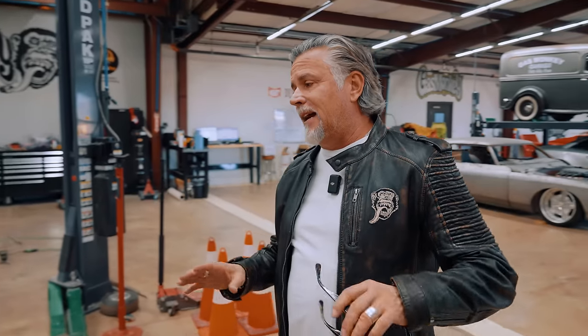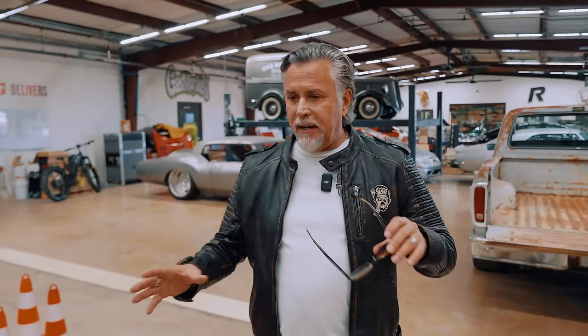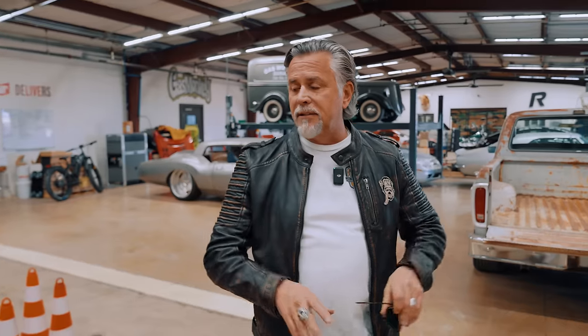So we got it all fitted in there, and we're gonna do one last test run now that we got the front wheels and the rear wheels mounted. Everything looks like it's where it needs to be. We'll do a final test run on the original components for steering and working the gas and the brake. And if that all goes well and the suspension's doing what we want it to do, then it's time to whack all that stuff off of the Hoss Fly and connect it to the original steering box and brakes for the front end. So let's see what happens.